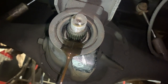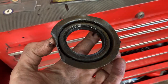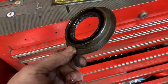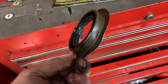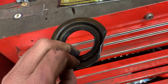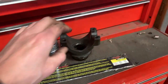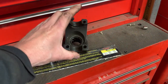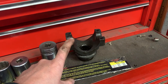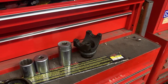Let me pop the seal off. Unfortunately there was no part number on the seal, so I'll go to RockAuto.com — a great resource for looking up part numbers for seals, gaskets, and brake parts. I'll throw a couple part numbers in the description. I'm going to Dr. Diff for the new yoke, stepping up from a 7290 to a 1350. We'll need a new driveshaft and a 1350 yoke for the driveshaft end too.